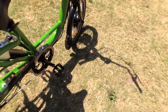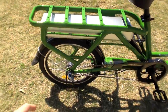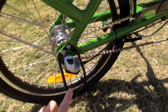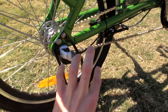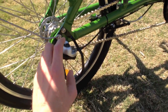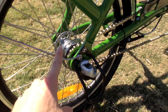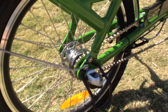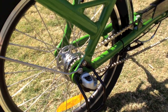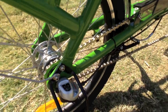And accidents happen. So even if something like that did happen to you, they built this bike to be really solid, obviously, but then there's this nice little extra. They've got a little guard here, and that protects the derailleur. And in this case, it's not actually a derailleur. This bike only has 3 gears, and they're built into this nice internally geared hub back here, and that's cool for a cargo bike where you might be stopping a lot, especially if you're a food delivery person or something.